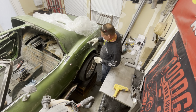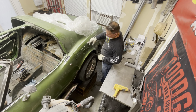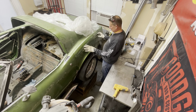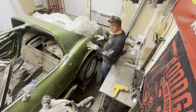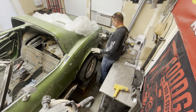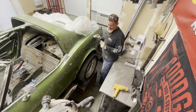What I'm trying to do is grind until I see fiberglass strands to make sure I get all the way down. Then I'll remove as much of that bonding material as I can - I want to make sure whatever I'm putting in here is new and adhering to as solid a structure as possible. I also want to make sure this corner is solid because it's cracked all the way through, so I'm probably going to take all this out and lay fiberglass in to make sure I don't have any issues after the fact.